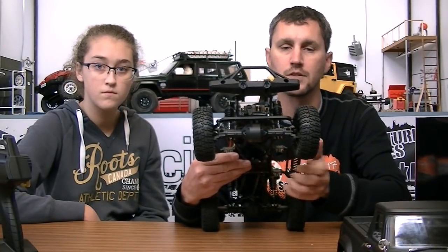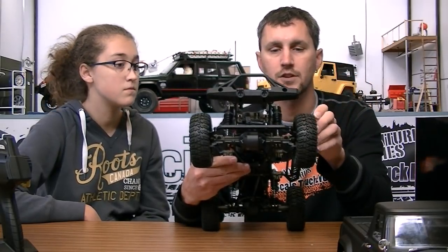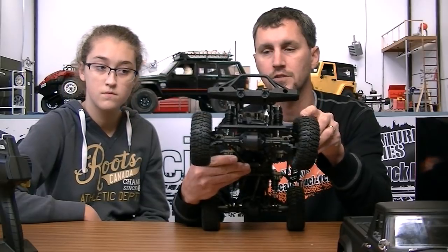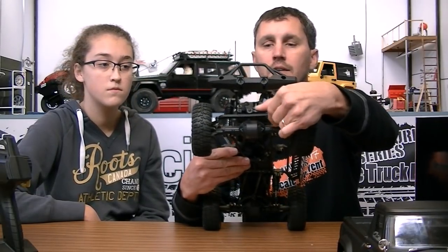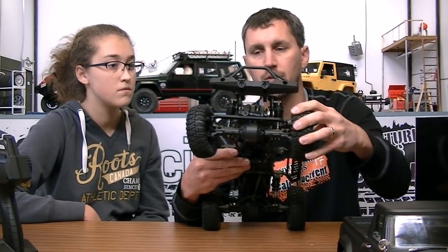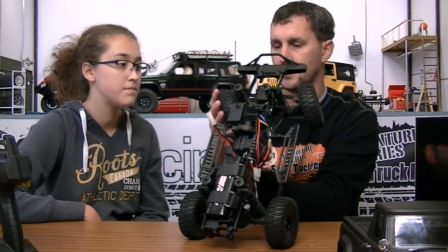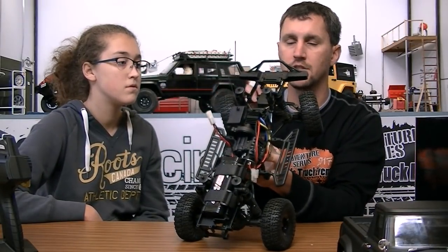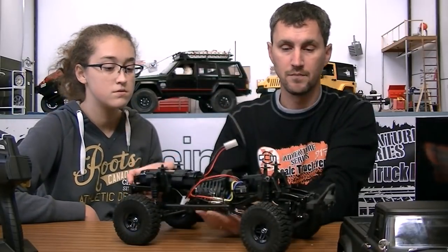There's a servo mounted on the axle. There's no kingpin angle on the steering, so it's got the old SCA-1 style of steering on it. And it feels like there's a lot of gears in the servo, so it's probably got some decent steering torque. The other thing I notice is the front axle already has CVDs on it, so I bet the steering angle is pretty good.